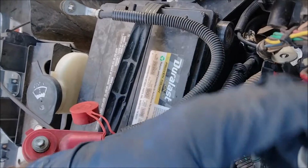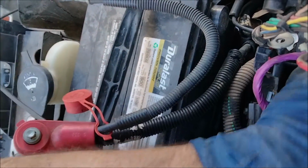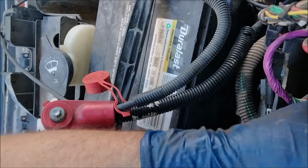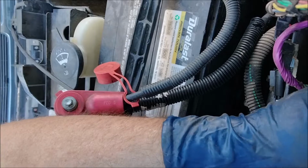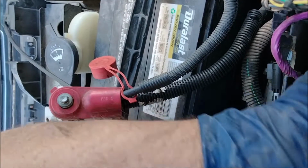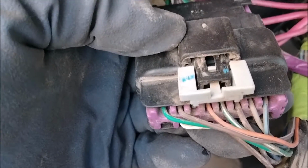The big thing is these, I forget what they call them, C100, C200 connectors. I know on one swap the wires didn't match. On that swap, it was for the check engine light, and I just had to take it out and move it over to the right pin. But you just want to verify. Like this one has 7 wires. It's skipping one, right? So you just want to see, I've got a wire here that goes to nothing.